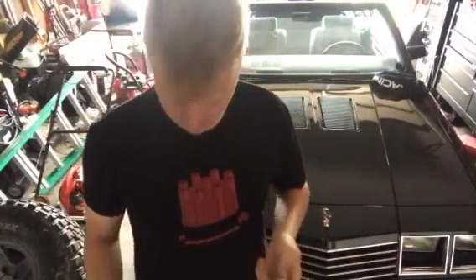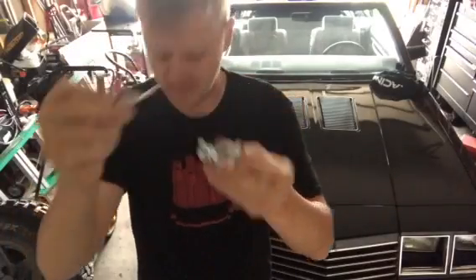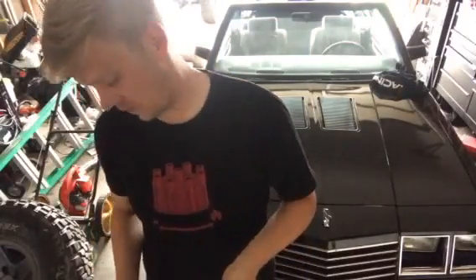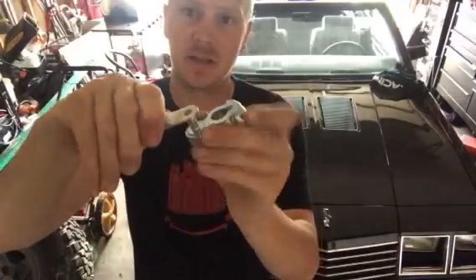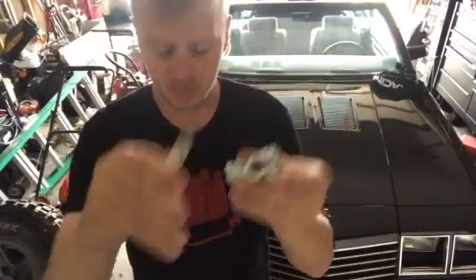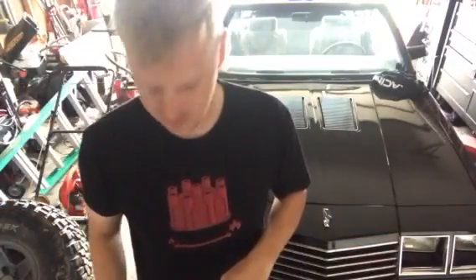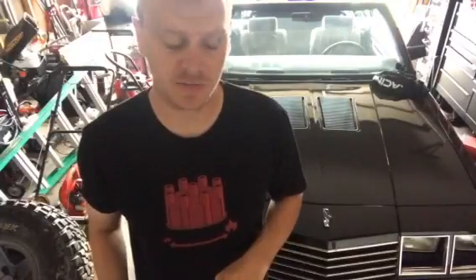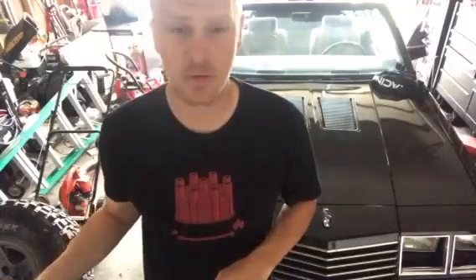With what I've got going on here, I've got this spade — it's got a little bit of play in it, which is really not going to hurt anything — but the problem is I've only got two of them and I need four. As it turns out, I've got four of these smaller ones but they don't quite fit over it super close, so we're just going to drill through it, ream it out one size bigger. It's just another step to the process unfortunately, so we're going to do that and then go ahead and slide our heat shrink over the other end and crimp and solder.